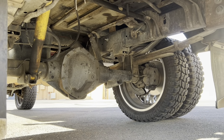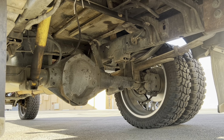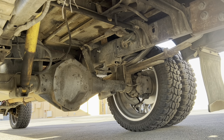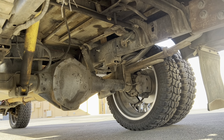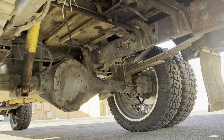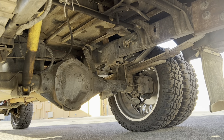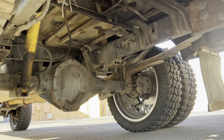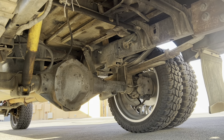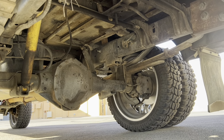So to solve the issue of the sloshiness, the softness of the suspension, I was thinking about either just doing the bags, like the regular trailer bags that you keep like 10-20 psi in, or I was contemplating doing air ride in the back and getting rid of the leaf springs altogether. There's a couple reasons for that, which I'll go into in just a second. I gotta get my thoughts straight on that one, because I know what would be easier, but I also know what would be way cooler.